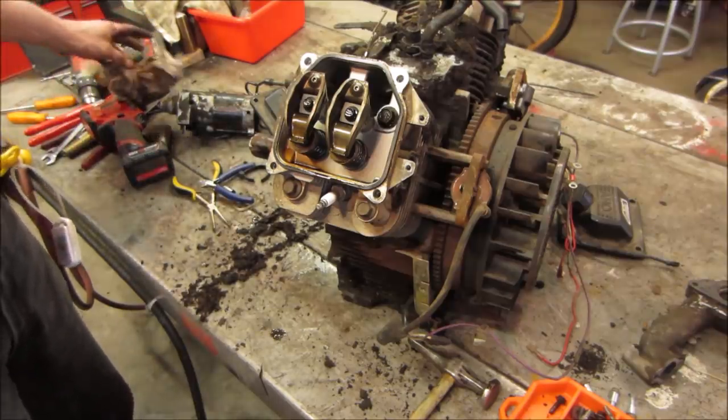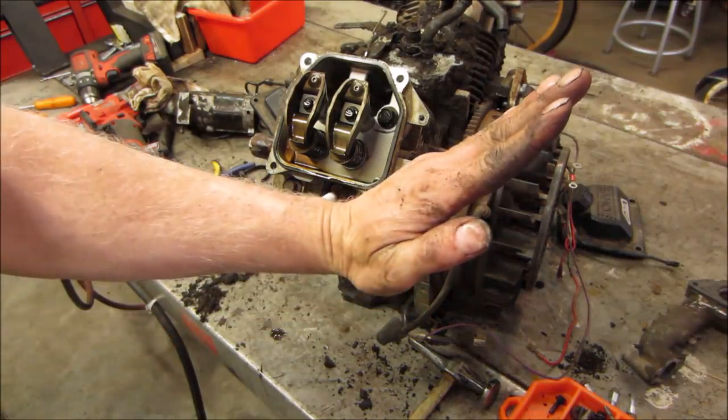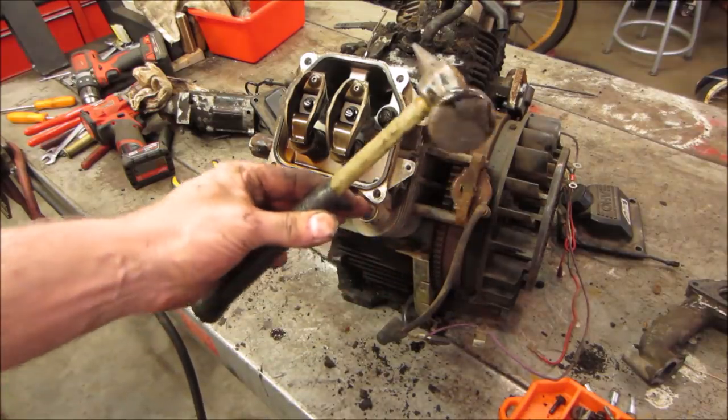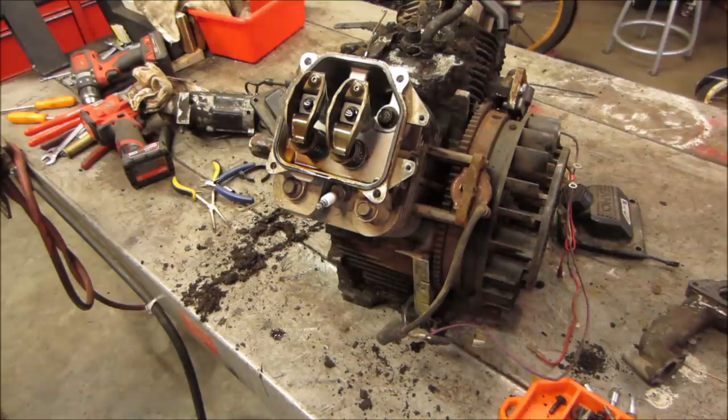I go over to look, and their son had moved the generator further away from the house, but he had it sitting on a hill like this. Well, it didn't run out of oil, but it was pitched so far that it was starving for oil. It was literally sitting on an angle like that on the side of a hill. I just looked at it and shook my head. I'm like, really? I gave you oil. I set them up, all locations, ran extension cords, the whole thing.